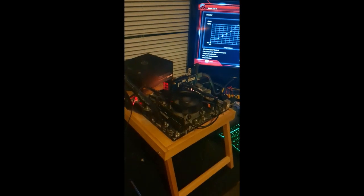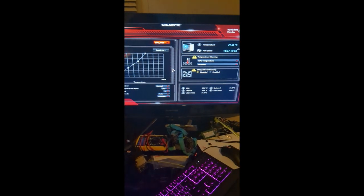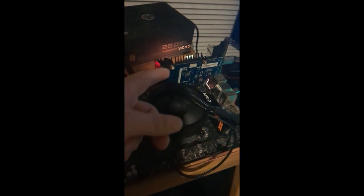Here it is on the test bench — and this is why we test bench stuff. These sticks of RAM just would not boot with this system. I don't know if it's the frequency — I've used these on Intel machines before, never on Ryzen. I know Ryzen can be more picky about the RAM it uses. I got a couple of eight-gig sticks in there and it's booting up now. So that's checking the temperature of the CPU. I thought maybe it was the power supply not letting it boot because the warning message said CPU, but I reseated the CPU, put a video card in, and it ended up being the RAM. This is why we test bench stuff.